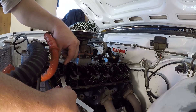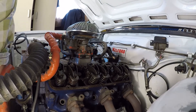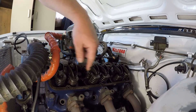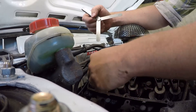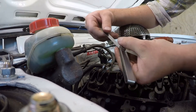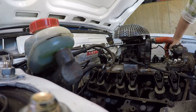Now I'm going to open valves eight and eleven — that's eight, so seven, eight, eleven — they'll be the next ones in the sequence to open. Now we can see valves eight and eleven are open, all the way down, and the valve clearances to check are five and four on the other side of the engine. We get the inlet feeler gauge of 12 thou — feels great. Now the exhaust: one, two, three, four, five — that's this one here — check it — that feels great. I'm going to adjust a couple of these so they're out of spec and show you how to fix them.